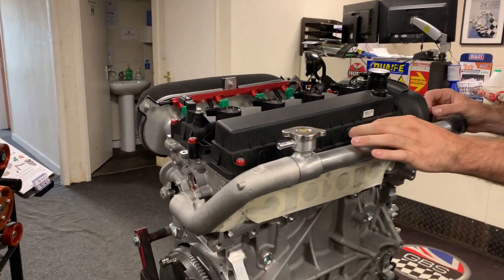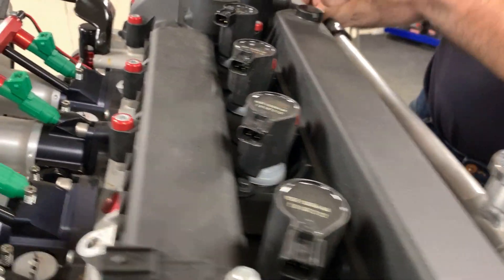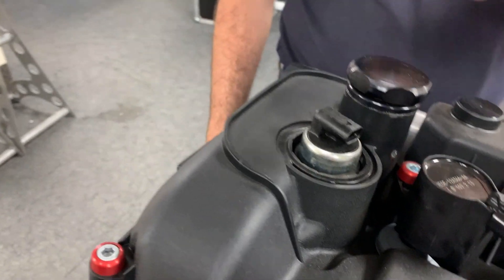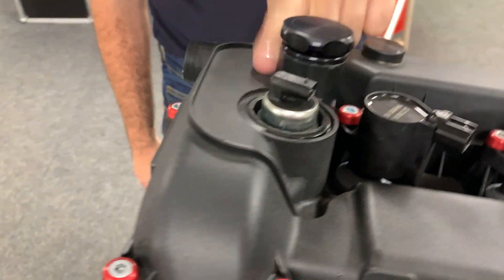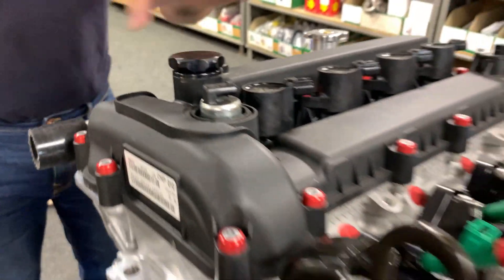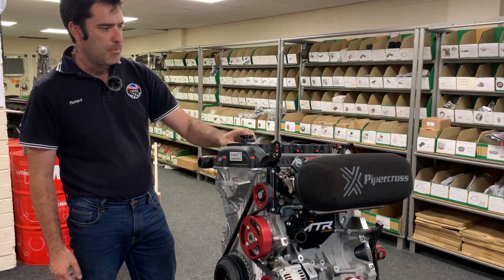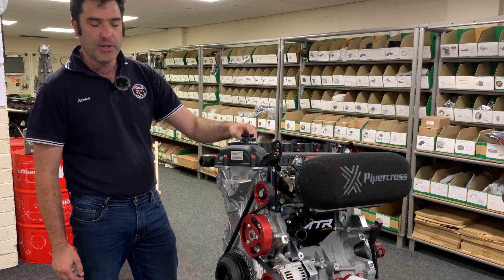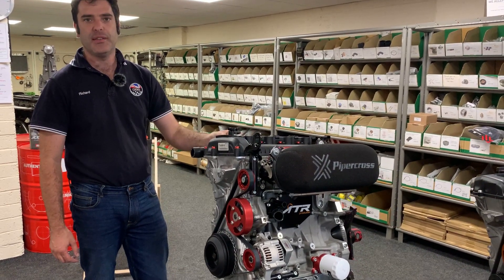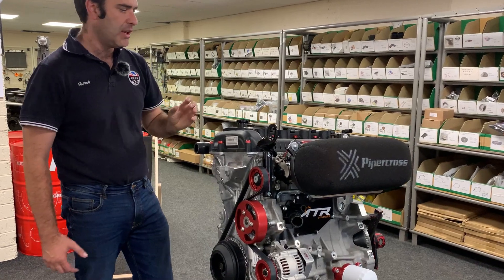We've got all the finishing bits to make the bolt heads look a bit nicer to finish it off. Then we've got a new oil cap — the standard Ford one is quite high, but we can cut this down to give more bonnet clearance. On the Escort we don't need too much, but if it was going into one of our Zeros we drop that right down. We also blank off the original Ford breather and fit a dash 10 fitting on the side of the cam cover with a 90-degree fitting into your catch tank, which looks really smart.